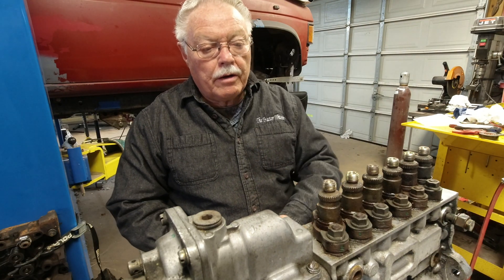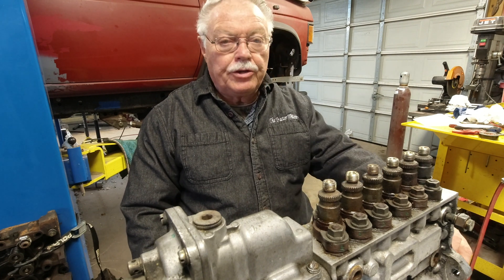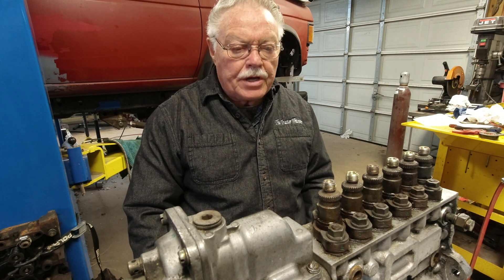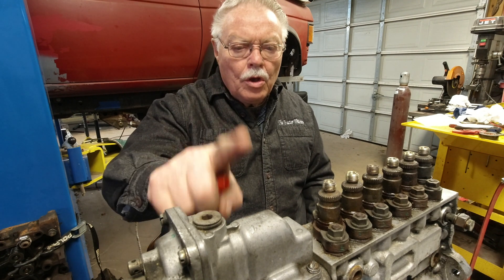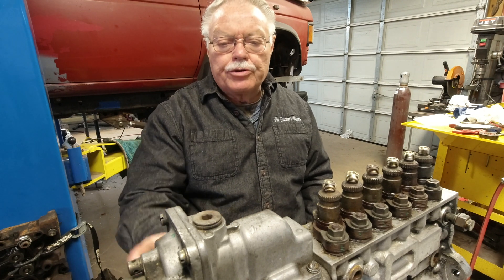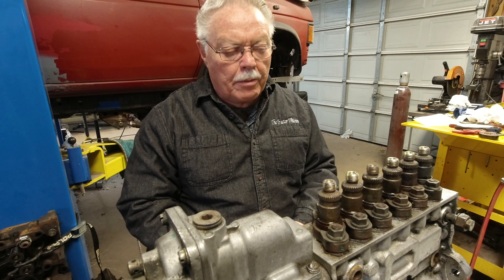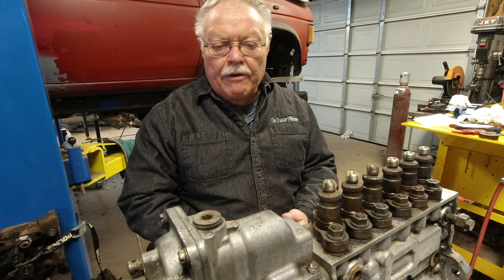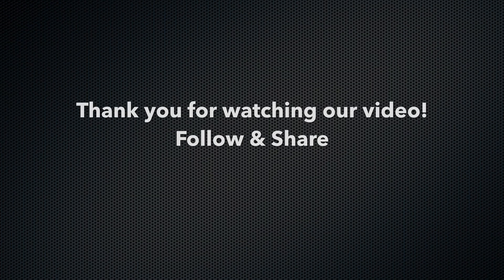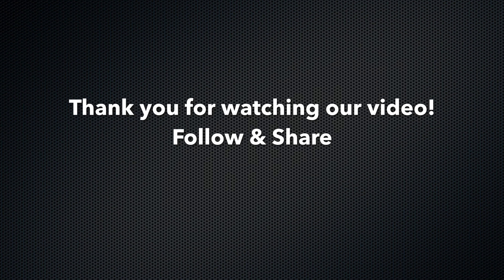Okay, that's got our delivery valves installed. Pretty straightforward. I hope you can see and that it's helpful to you going forward. If you like this video, please like it and subscribe — subscribing to us helps us a lot. Our next video we're going to pull the AFC housing and modify it for AFC live. We'll add 21 millimeters of travel and put a long spring kit in it too. After we do that it'll be ready to put back on the motor. Thanks everybody, Gary Parker Bennett — we appreciate your time.